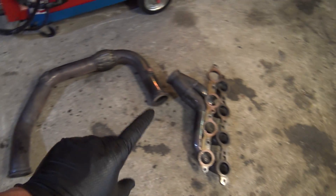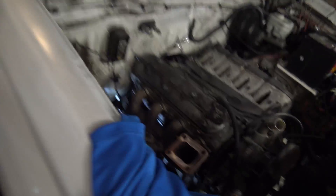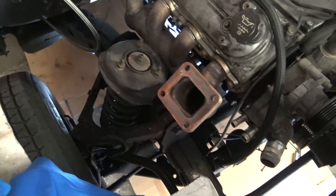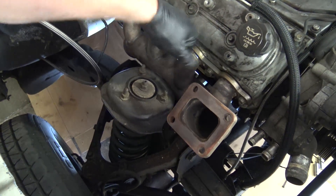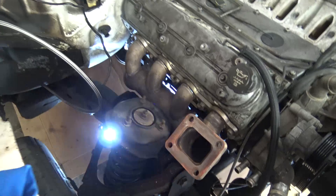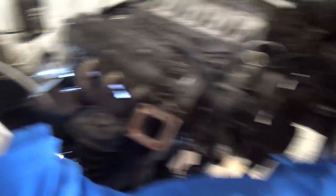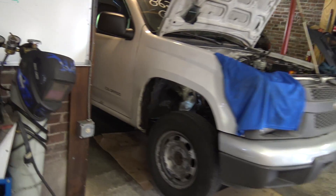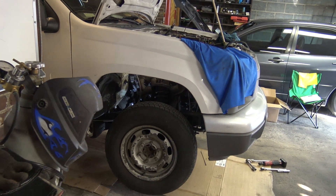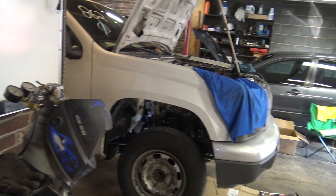I just pushed this guy back and took out the crossover tube so I can pull the headers, because it's way easier to get to the engine mounts — they're underneath these and fitting them in between here makes it quite a hassle. So I always just pull the manifolds; they pop right out. I can get to the motor mounts, pop everything out, just disconnecting everything, pulling it out. Then I'm going to swap some stuff over and show that on video, then show the prepared 4.8 dropping in and assembling everything back together. Just pulling it out isn't that exciting, and it's like 90-some degrees — it's killing me out here. So all you're going to do is watch me sweat, and I'm not interested in showing anybody that.